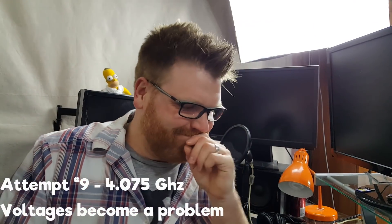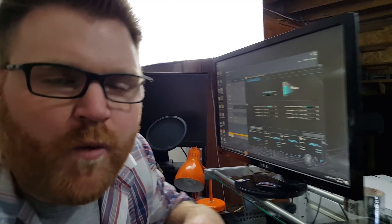1760 — oh my goodness gracious, that is insane! I don't think it's gonna do it that Cinebench run though — that was bananas. I'm gonna load back into Windows and see if I can do the sleep mode to get it to like minus 10 and run it real quick one more time. One last hurrah. I want to explain how I did this. My motherboard only gives you a voltage offset — it only lets you move from 1.3-something up 0.2 or down 0.2, it doesn't give you specific values.